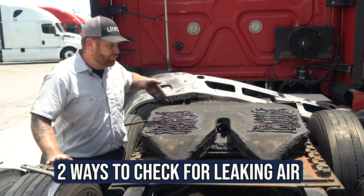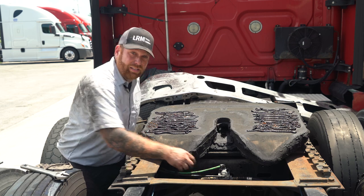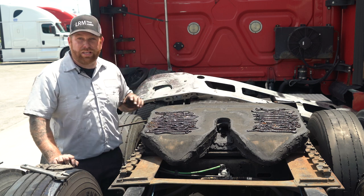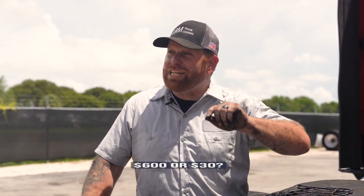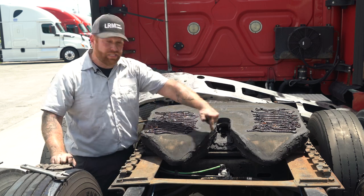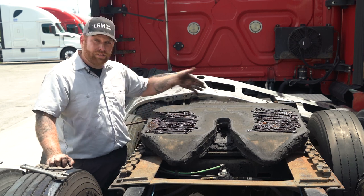This was the follow-up from another video I did for air leaks about this particular valve — it will show you how to diagnose it. There are two ways to check. If this front valve is leaking at any time, I would always check by pinching the top airline. If the air goes out, replace this first. If it doesn't, and I've seen it where you don't hear an air leak but the brakes are still applied — the shop's always going to say ABS. Think about it: $600 or 30 bucks. Start with the cheapest one first and 90% of the time that's the problem. If the technician is adamant about it, just say it's fine, 30 bucks, I want to replace this — and if it fixes it, you saved $600 plus the labor.